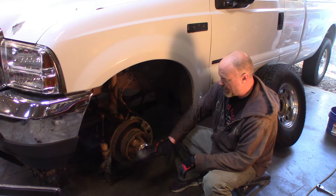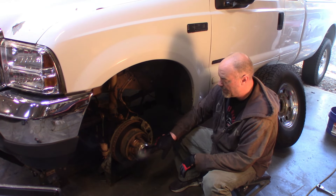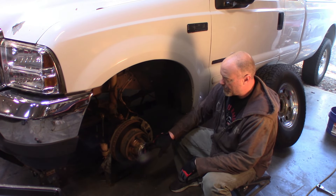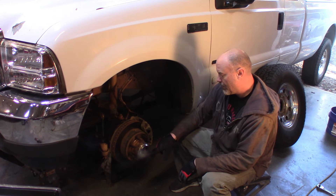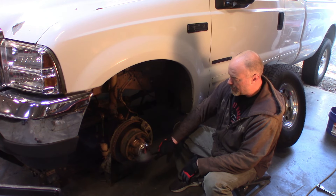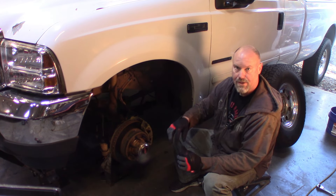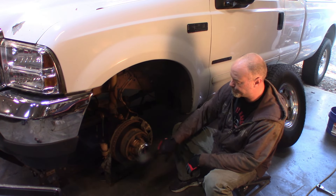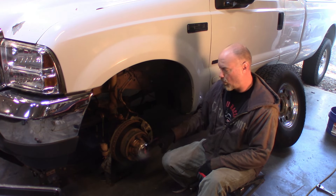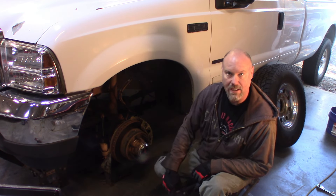That's one of my complaints with the G2s, but their support is nice — I called G2 when I had to drill out two of these screws, and they'll send you a pack of replacement screws for free if you email them a picture. So they know they have a problem there. The easy fix when putting them back in: put some anti-seize around the outside of the head where it grabs the hub. And don't use an impact gun getting these off or tightening them down — use a wrench so you don't strip that little T15 screw.